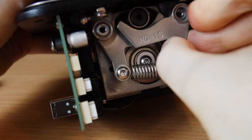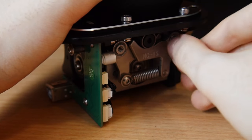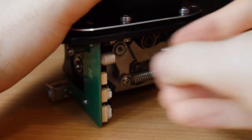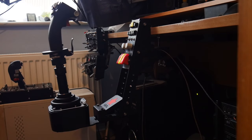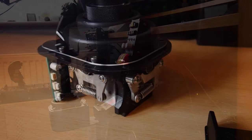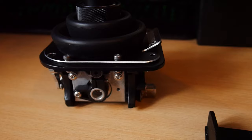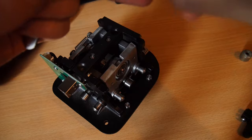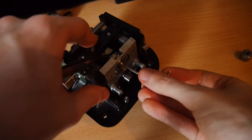Switching it up for an extension, I'd personally go for a soft centre and gradient too, with medium or hard springs. The process of swapping components is slightly fiddly the first time, but easy to remove and replace from the base without too much fighting. Extended, you'll find the stick doesn't have a serious spring rebound, but the tendency is increased. This is where the optional dampers can come in, in what is an unofficial configuration. You can attach the dampers and springs at the same time; however, you should take care doing this, as the retaining nut on the far side is hard to replace should you drop it from its socket.